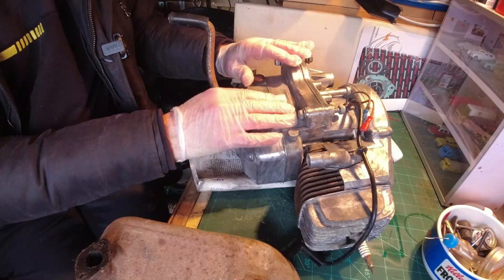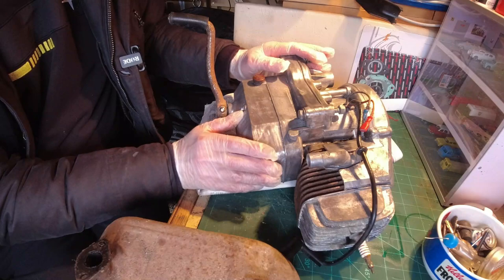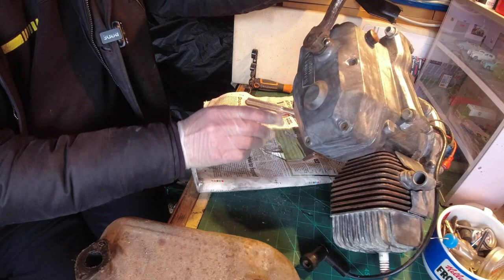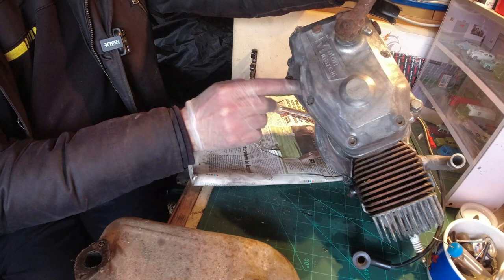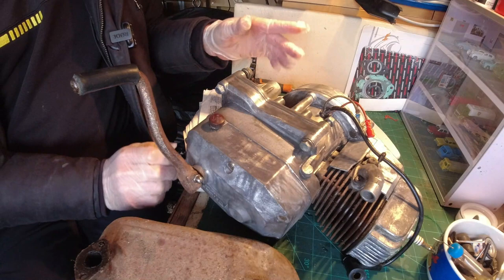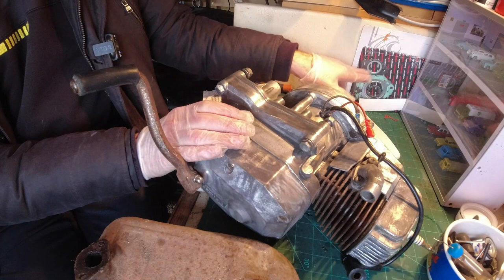I've had a little bit of a go at this - given it a clean up. It had aluminium oxide all over the side and it's all been sanded back now. I don't think I'm really going to get a decent shine on it, but just make it look decent. It's a Minarelli V1 engine. I've also drained the oil out - it didn't look that old to me, but at least it had lubrication in there. This is the drain plug, this is the level, and this is the filler. I'm waiting for some oil to come. I did order a set of gaskets which I can't find - I've ordered a set coming from Italy.